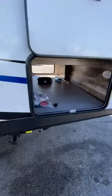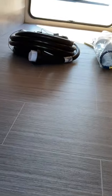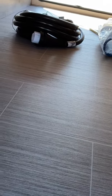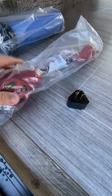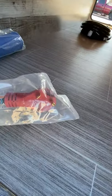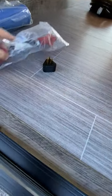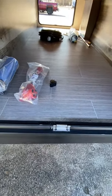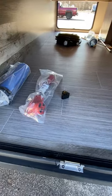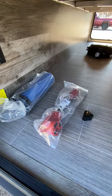Going to the pass-through storage, we have a few items in here. You have your power cord right there — that's a 50-amp cord. I'll show you where that plugs in on the inside. And then the 50-amp can plug into this, which is a 30-amp adapter. That will plug into that so you can plug it in at home if you'd like. As far as plugging it in at home, you can pretty much run just about everything but the AC — don't try running the AC, you might blow a breaker at the house.